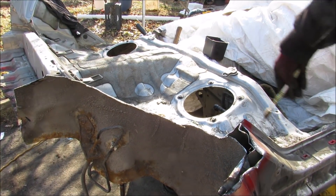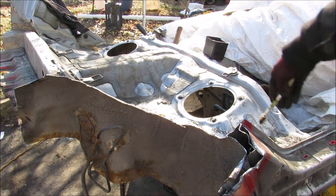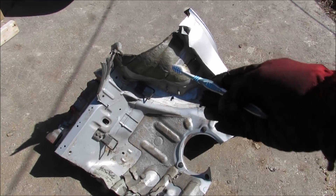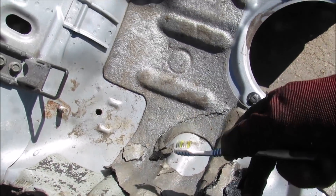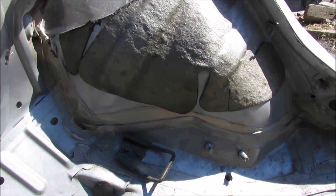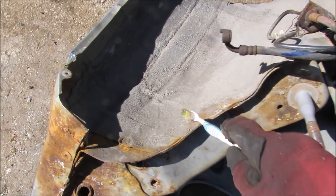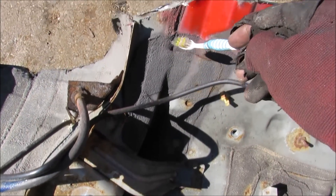The next step is to cut the part over here on top of where the gas tank used to be. I'm going to be cutting through the rocker panels — as you can see they're made of multiple layers — with the sawzall, and then the rest can be handled with the angle grinder. Look at all that rust. This here is where the rear seat would mount and the rear wheelhouse. You can see all over the body we have this sound deadening material, just to stop road noise and unwanted sounds from entering the cabin. We've also got body sealer along a lot of the edges to keep everything watertight and airtight. On the bottom of the quarter here you can see where the frame rail from the side sills actually goes around the wheelhouse and leads towards the trunk. We've got a mount for the rear subframe, the wheelhouse with undercoating to prevent rock chips, and although this is galvanized steel there's still a rusting issue on the bottom.